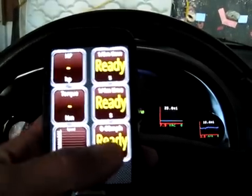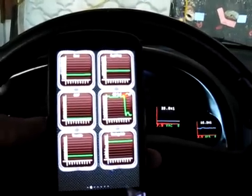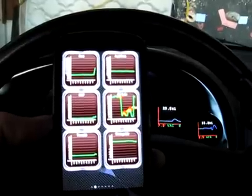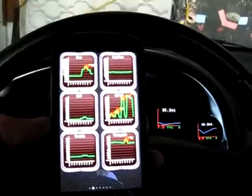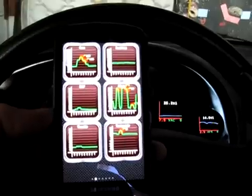Not sure how well it works — I haven't really tried it out yet. It gives you a bunch of cool OBD2 data. You can get your RPMs, fuel pressure, MAF reading — it's a relative MAF reading, not the actual MAF counts. You can see the O2 switching, throttle position, and timing.